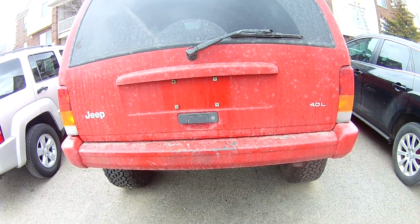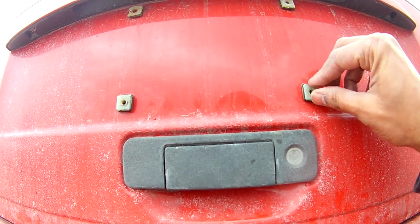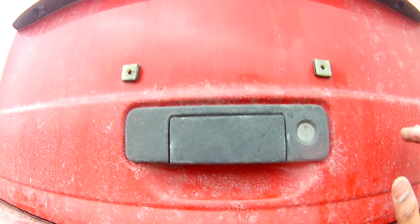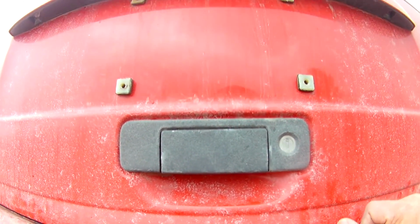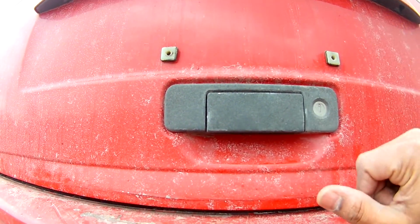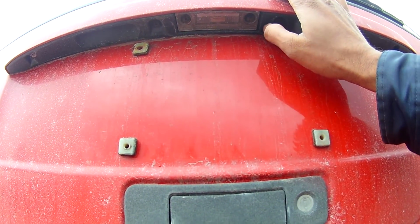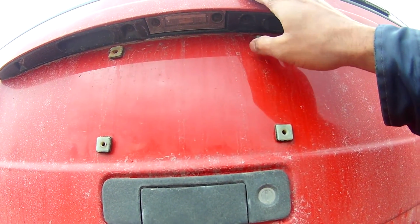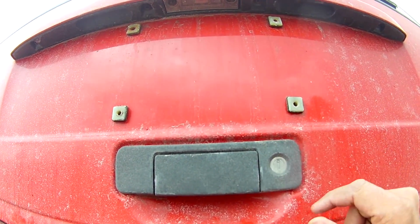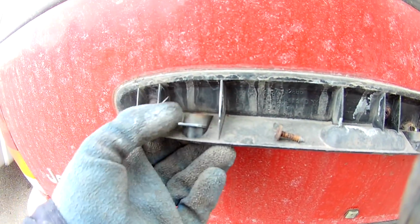So from the beginning, you can use one of those holes to take your wire inside, because you don't need 4 holes to hold your number plate. So you can use either one of these, or you can use this place, but you need to cut or drill a hole here to take the wire. But definitely you need to remove this cap to take the wire inside, so I need to decide which one to use. Okay, I did remove all these 4 screws.